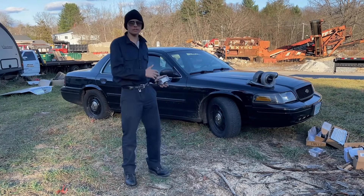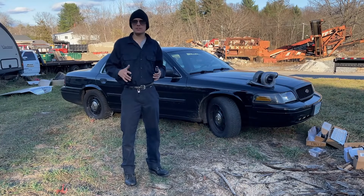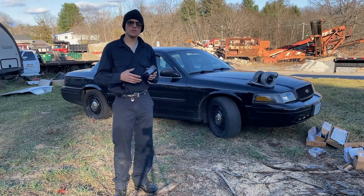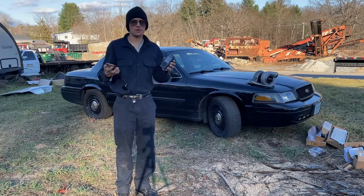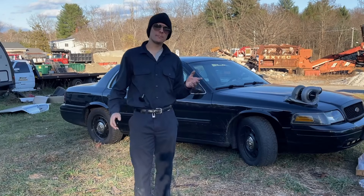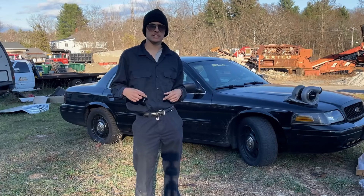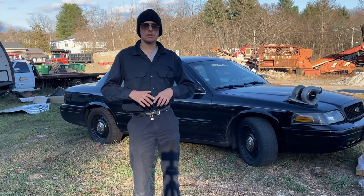Now we have all of our parts — let's say they're all put together and you're ready to fire up your car. But when you fire it up it is not running right, and that's because your car is not tuned properly. That's where this comes in. This is a Marty tune that you buy from Moe Speed Shop. When you buy this tune, talk with Marty and let him know exactly what you're doing. As long as you have a Windows 10 laptop and a mobile hotspot — I'd suggest using your phone as a hotspot — he can tune your car remotely. Just make sure your laptop is updated. I'm going with the 39-pound factory Ford injectors, which Marty already has the specs for. If you end up going with aftermarket injectors, make sure you buy a set that comes with a spec sheet explaining all the specifications. Do not set up an appointment with Marty unless you know all of the specifications of your injectors or it'll be a big waste of time.